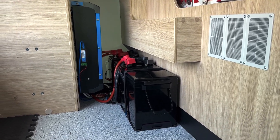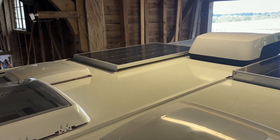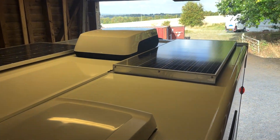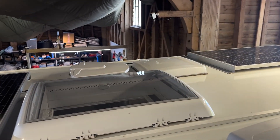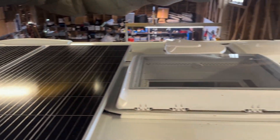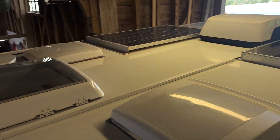Up here is what we've got as far as solar is concerned. We've got three Victron 185 watt panels and the original 120 watt panel that came with the van — we just left that in situ. The customer had a Truma aircon fitted, which worked well, and we still had space to put a 185 over there and squeeze in two 185s here, taking the total solar capacity to over 600 watts. They were wired separately so the original wiring goes through the roof to the Red Arc, and we ran new wires for the new Victron array.